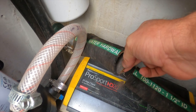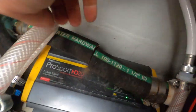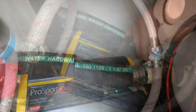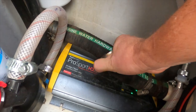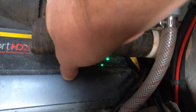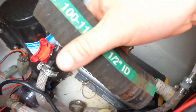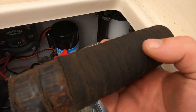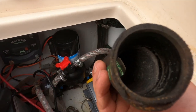You can get an idea of what we're looking at — the rubber is definitely cracked. I can see cracks on the inside, so it's definitely time. Getting the clamps off — luckily they were quality stainless steel and look like they'll come off okay. One side down, and you can see all the cracks in this hose. We were definitely due for these to be replaced.